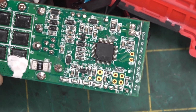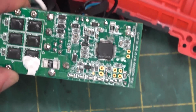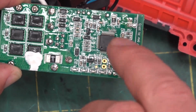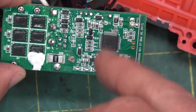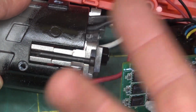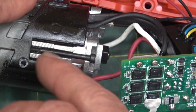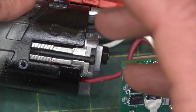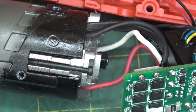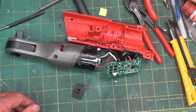It's probably spun up specifically as a brushless DC motor controller with some ancillary sensing and some analog inputs and stuff in order to take feedback from the Hall effect sensors in here. Hall effect sensors just measure the magnetic field of the rotor, because there are permanent magnets in there. That way it times.